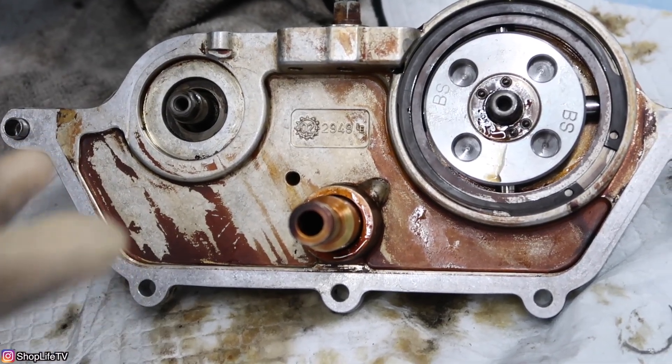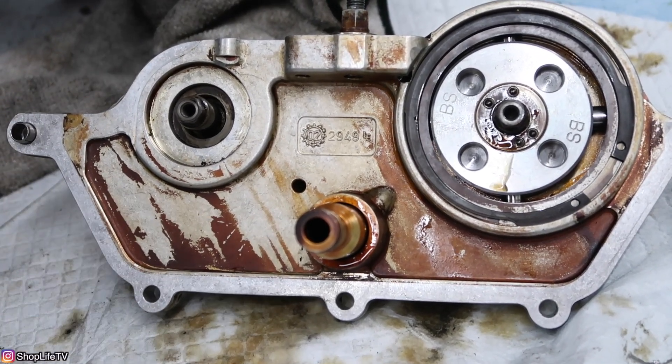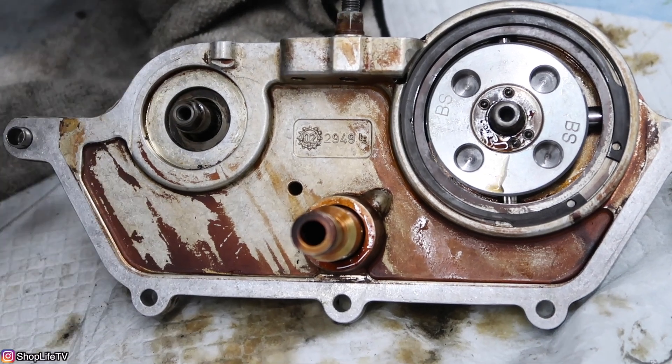Alongside the rattle kit, we are also going to be changing all of the sprocket bolts and upgrading them to the latest revision, which are a little bit stronger. As I showed earlier, I was checking for top dead center using the timing kit. If you're only doing the Vanos seals, you really don't need all that timing stuff because you're not going to mess with any of the timing-related components. But since we are doing the Vanos rattle repair as well as changing the sprocket bolts, we are going to need those timing tools.